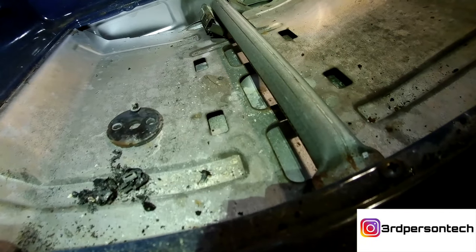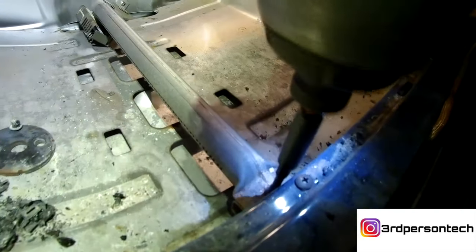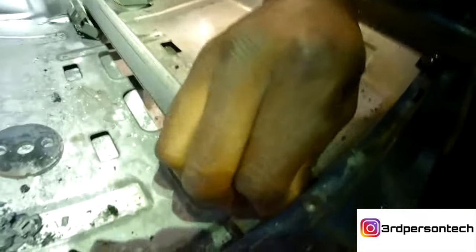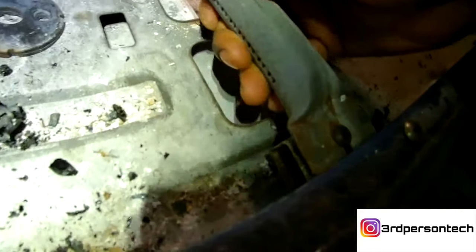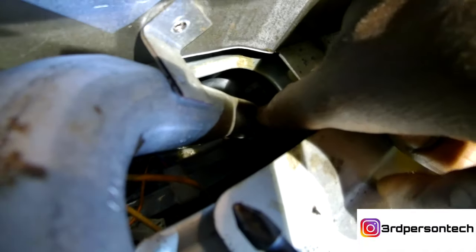In this particular oven we're gonna have to remove the entire burner in order to access the igniter. There's one screw hole at the back and one screw hole at the front — we're gonna remove those two screws. Sometimes they can be a little bit rusted, so take your time because these screws can strip. Then we're gonna get the screw in the back at the gas valve hole, and once those screws are out we lift the burner tube forward, off the gas valve, and pull it right out — just like that.